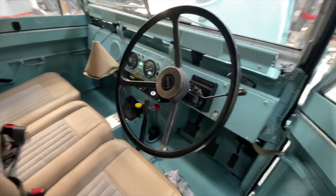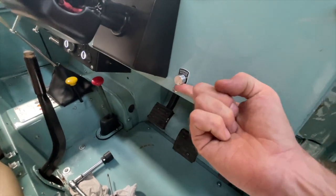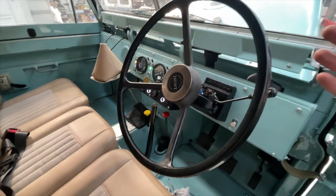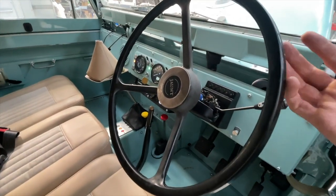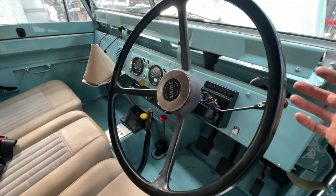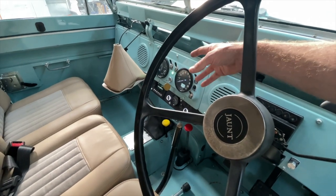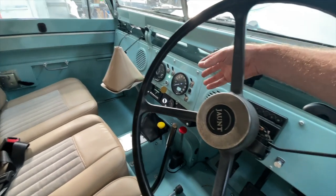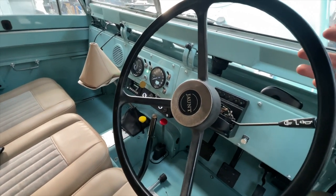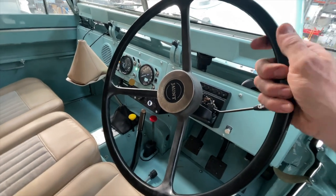So yeah, it works. We've got an adjustable dial for the rate and the amount of electric assistance. Too much and it feels really floaty, too little and it's not that helpful. That's helpful for us to test it and find the rate that we want. We're actually able now to take a digital pulse to give a speed, and we can use that information to have it adjustable based on speed, like a modern electric system would do. So less at higher speed, so it doesn't feel too floaty and dangerous on the freeway.